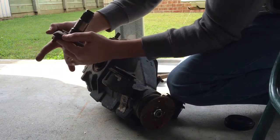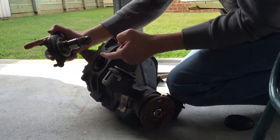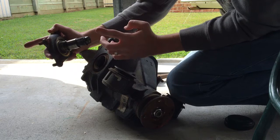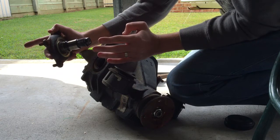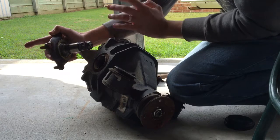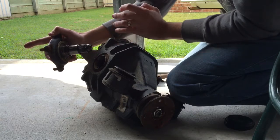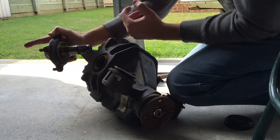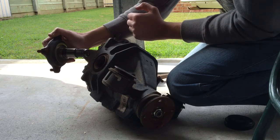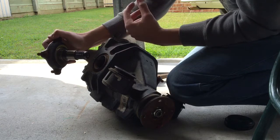Now the oil level - this is a bit of a tip - the oil level is at the bottom of the seal. So if you're doing it in the car, you shouldn't need to dump the oil out of the diff. If you're literally after a quick swap, you can do it without draining the oil. While you're there, you might as well change the oil for the extra five minutes it takes, but the oil level shouldn't spill out everywhere.